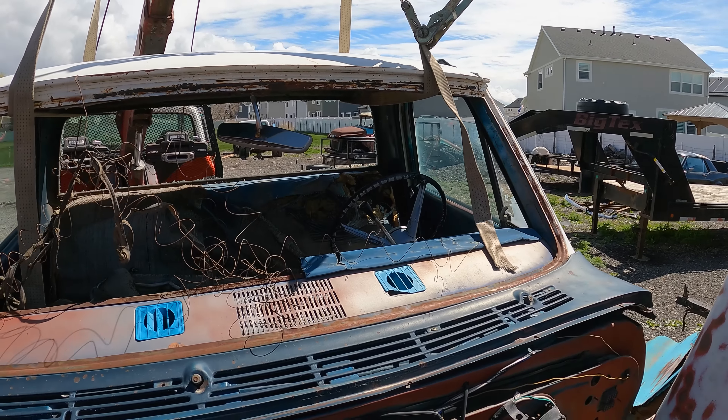More and more I drive that truck, the more I love it. I want to put some miles on it. I think we've got enough parts bolted down solid that I can actually drive it down the highway — although we do need to do something with the tires. We need to get some balance beads in them, especially those front ones. There's one that's got to be about eight ounces out of balance because as soon as you hit 60-65 mph, it feels like a big oval up there — gets a little sketchy.